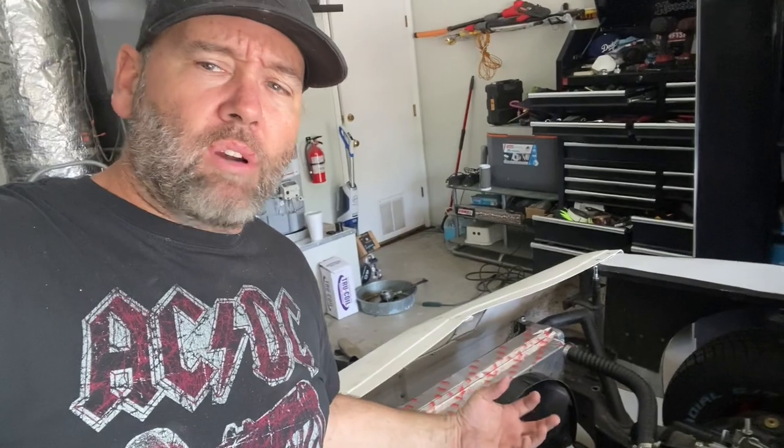Here's something some people may not agree with, but in my experience it worked. I was in tech lane one time and my car was running hot. A fellow competitor came up and said if you want to cool that thing down, run the fan closer to the radiator. I said I had a good shroud already, and he said trust me — just put the fan closer, it'll cool it down 10 to 20 degrees.